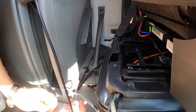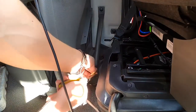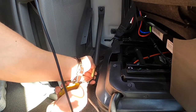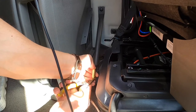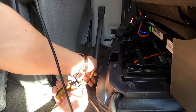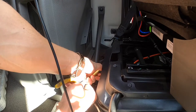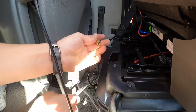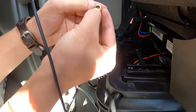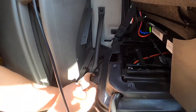To remove this gold coupling, you want to make sure you release all the air from the air tank first. If you don't want to do that, you have to press one of the ends — I already connected the other side. You press it in, it goes inside. When there's a lot of air there's too much pressure and you won't be able to push it in. So push it in and pull out the other side — there you go. You push that in, it goes inside, and you're able to release and pull it out.